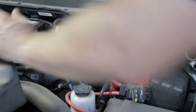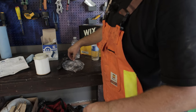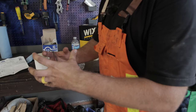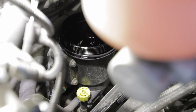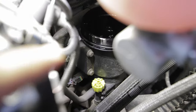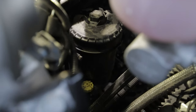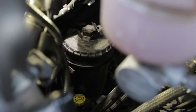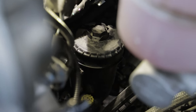What I'm doing is just pushing back and forth and pulling straight up. The way this filter is, it doesn't thread in — it just kind of pops in. Pull it right out of there. It's pretty straightforward — the new one just wiggles back in the same way it came out. You have a large O-ring here which goes on the actual filter housing — pop that off and change it, make sure you get the grooves right. I tightened up the drain screw — it was just a half turn. Pushed the filter in, pushed the O-ring all the way down, made sure it's seated all the way around, then threw the cap on. There's a torque spec but for cartridge filters I just go as tight as I can — you'll feel it bottom out, hear it squeaking, and then it stops.